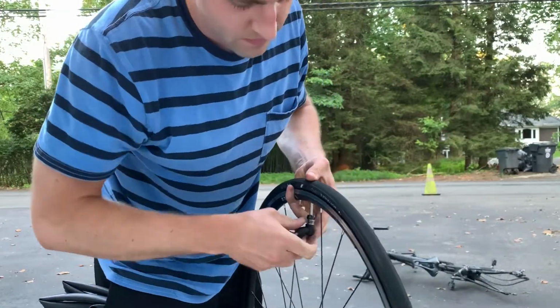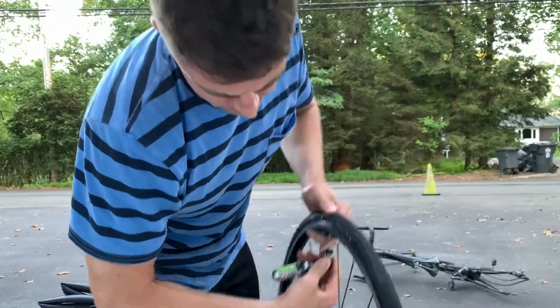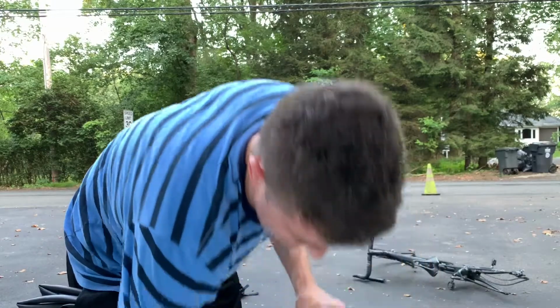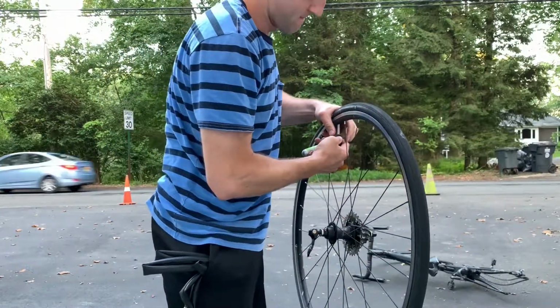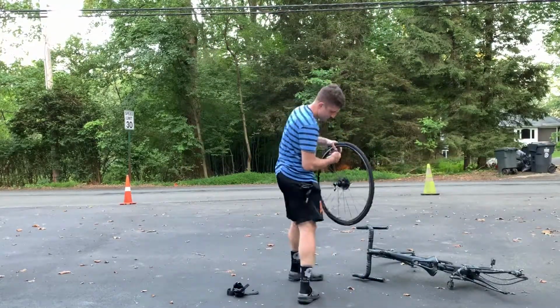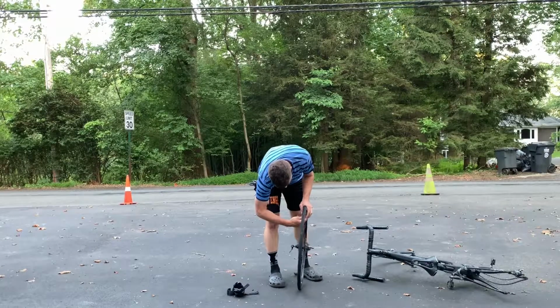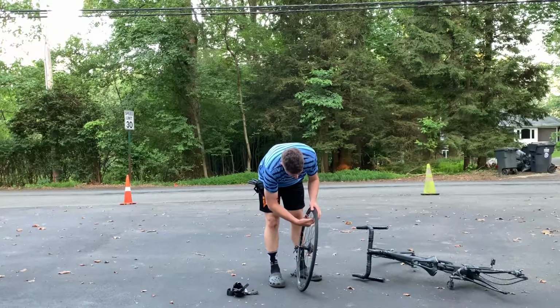I'm going to use CO2. Tighten that thing on. When you're putting the inflator head on, you've got to tighten it on real quick onto the CO2 cartridge. And when you're ready to fire, just watch your hand. That CO2 gets super cold. If this is a hot summer day and your hand's sweaty, it's going to stick to that CO2. It'll rip your skin off. I mean, it really, really gets cold. So just protect yourself there.